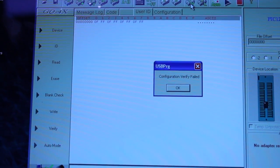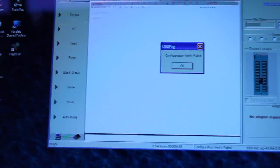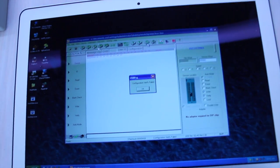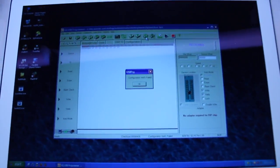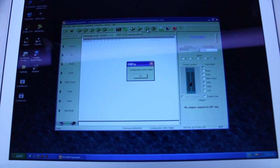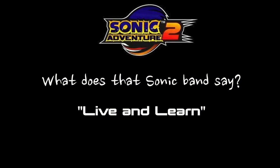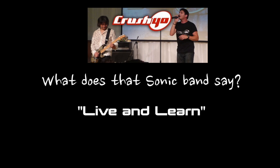Configuration verified failed. There you go, all done. These are only one-time programmable, which means I've just thrown out a chip. It's funny because I later found out you could use some updated code of MM3 or some flash chips which are rewritable, so I'm going down that path. Stay tuned, we'll have a proper video on it. Thanks for watching — hope you learned how not to flash a mod chip.